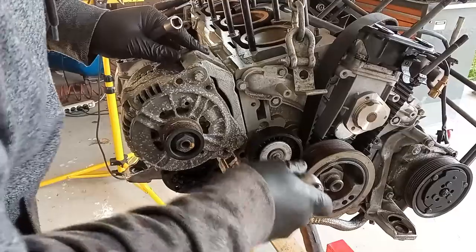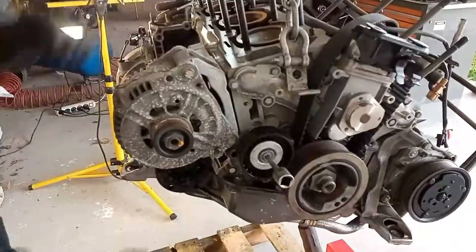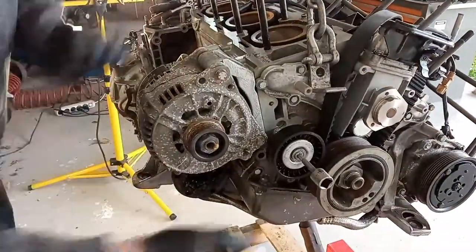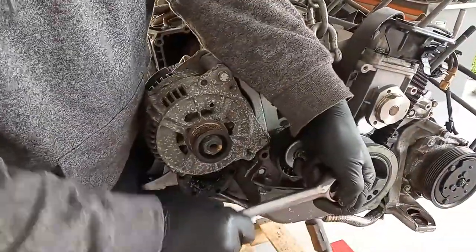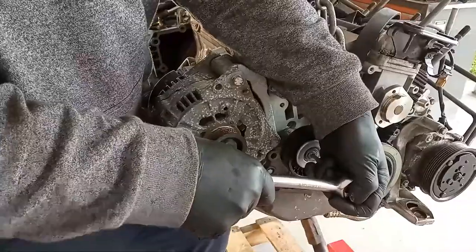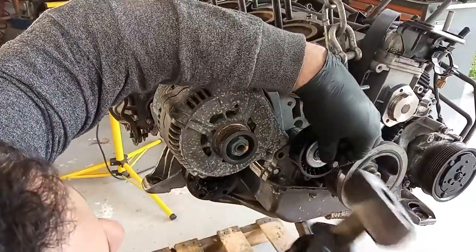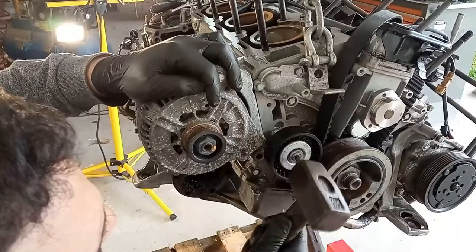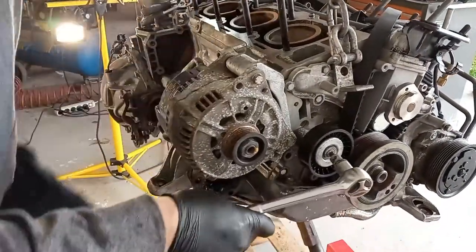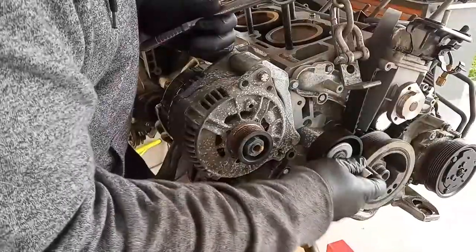This 6mm socket is really good. The one that I have is a better one, from the time when better meant quality. And the bolt is garbage. Someone did try to take that out or put it in, and the bolt is really messed up. So I do the trick that I did on my Alfa 155 and just hammer a bit. Just a nudge there with my hand, and here you go. I will deal with this later. Just putting a new screw in, not a big deal.